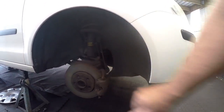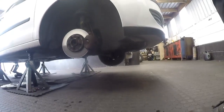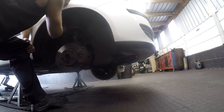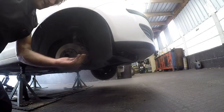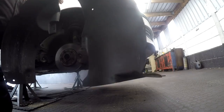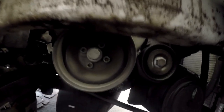It is best to remove the front wheel, which I did. And then this inner arch skin — we're going to have to take it out. It uses those same self-tappers, just a few self-tappers all around, and then the skin comes out completely. I've counted about 14 of those self-tappers holding this skin in. So quite simply, take it out and put it to one side. Now we can see that the pulley is basically exposed and we can get in there. For that we're going to need a size 18 socket or spanner and a size 6 Allen key.